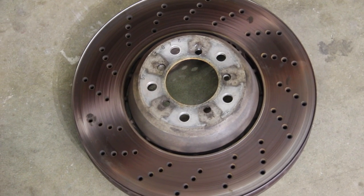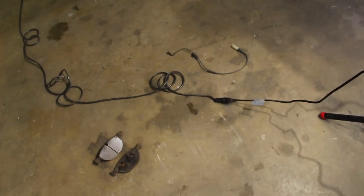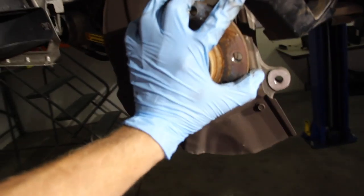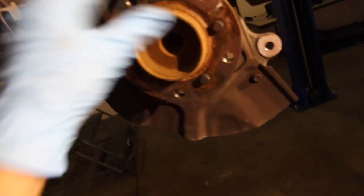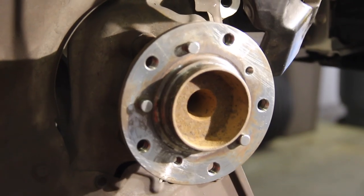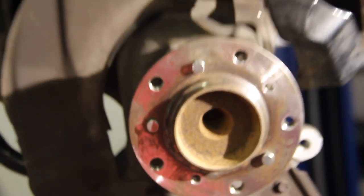They're 5mm female hex bolts - the rotor set screws. They came out, but then the rotor didn't want to come off. So I used a nice little dead blow - a 16-ounce rubber mallet - a couple of taps. Put your hand kind of over the whole hub if you're going to tap it so it doesn't fly off and break your concrete floor. Two taps and it came nice and loose. Now we can get a great look at the wheel bearing. This is a good time to take a wire brush and clean up all this corrosion. Take a listen - if you hear any clicking, it's time to do a wheel bearing. This one seems fine, so I just cleaned it up with a wire brush and a couple splashes of brake clean.